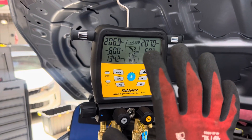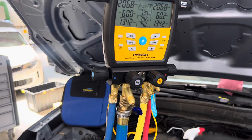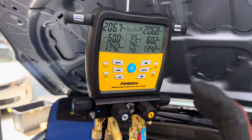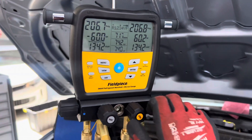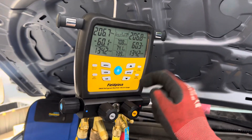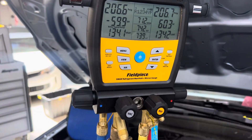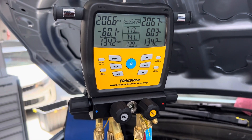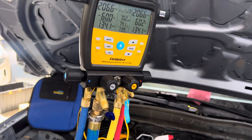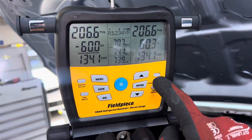We're close to my target pressure of 200 psi. The reason I use this pressure is that this is a microchannel — a strong evaporator. This is not a 1960s Cadillac with large bellows evaporators; I normally would not test an older car at this pressure on an evaporator, as you could create a leak. Now I'm going to isolate the nitrogen — nitrogen's off — and open up both sides, high and low, to let them stabilize side to side. Then you wait about 10 minutes for all the rubber hoses to relax and pressure to drop a few tenths.